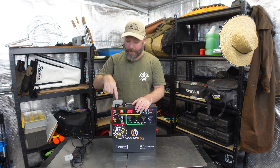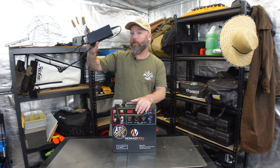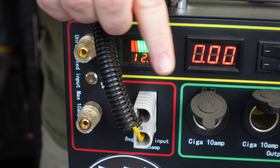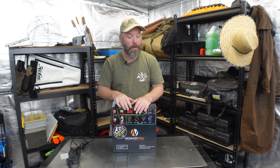If you've got a DC-DC charger, a solar panel system with its own MPPT controller, or you're using the 240 to 12 volt regulator for charging at home, then you can use the Anderson plug at a charging rate of 25 amp — and that assumes you've got that external regulator.